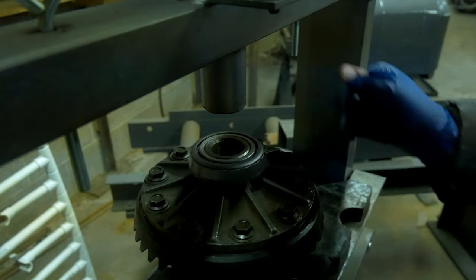And this measurement, I know the angle kind of looks weird, but we're getting right at 4.5 thou backlash, which is a half thou below what's recommended for the tightest tolerance on the factory spec. But again, with brand new bearings that have never been really rotated, I expect I'll get a quarter thou a piece from pretty much everything in the differential. So at 4.5 thou, I can sleep at night, and I'm not going to worry about it. The next thing you're going to need to check all this stuff and make sure everything is where it should be is some gear marking compound.